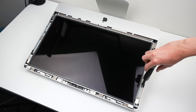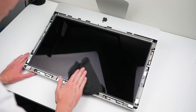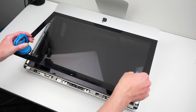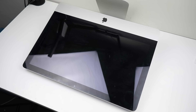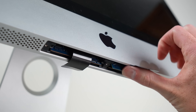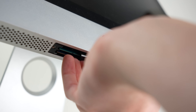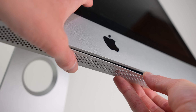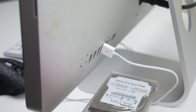As we're installing glass over the top, it's important to remove any dust, fingerprints or marks from the LCD panel itself before we attach it — otherwise it'll be trapped in between the two layers. After that's done, I can reattach the glass panel back into place. The last upgrade left is the RAM. I'll reinstall the original four gigs of RAM and add two additional two gigabyte sticks, bringing the total to eight gigs. It can support up to 32 gigabytes, but I had this RAM laying around and eight gigabytes should be enough. After installing the RAM door, it's time to test the computer. I'll also need to install an operating system on our new SSD.